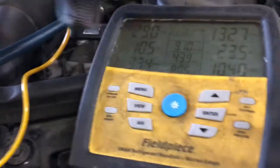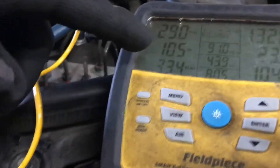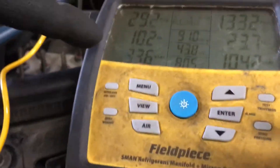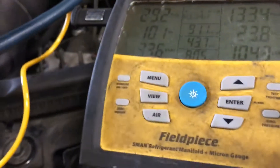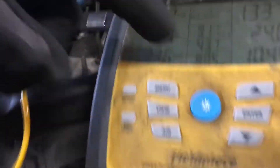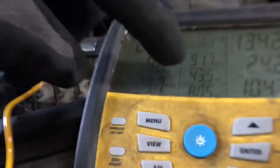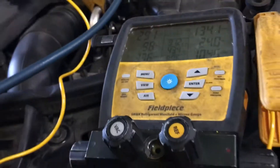It's just not going to happen. So I was just using yesterday's subcool to this subcool and superheat. Compare yesterday to today's superheat and suction line temperature. When I close the doors and windows, the suction line temperature drops down to 32 degrees.